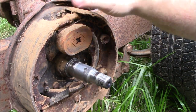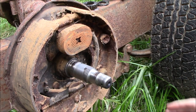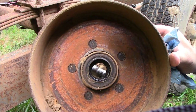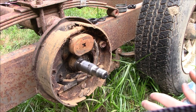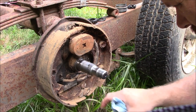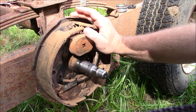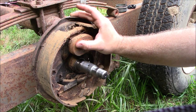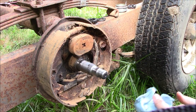So this backing plate is gonna have to be replaced. We're just gonna buy the whole backing plate set — you can get it on Amazon or a couple different trailer supply places. This thing here isn't extremely bad. We'll pull that seal out and clean that bearing up. We might replace that bearing, but we'll definitely replace the seal. If you can see the corrosion in here — these bolts are really bad, the pads are corroded, all the springs are extremely bad. This thing was probably under ten feet of water for probably a week during a flood about two years ago. Once the flood waters receded it just sat in a guy's field for about two years till I came and picked it up. All that water being in there did not help anything.